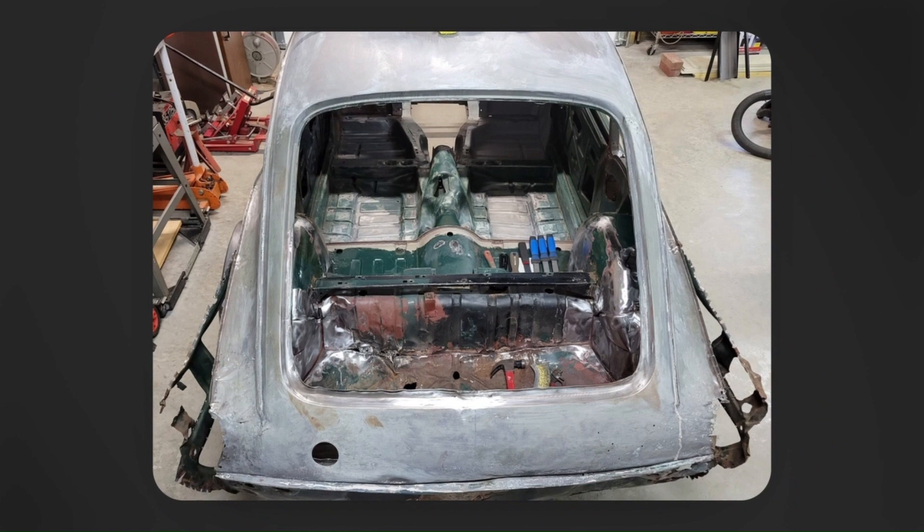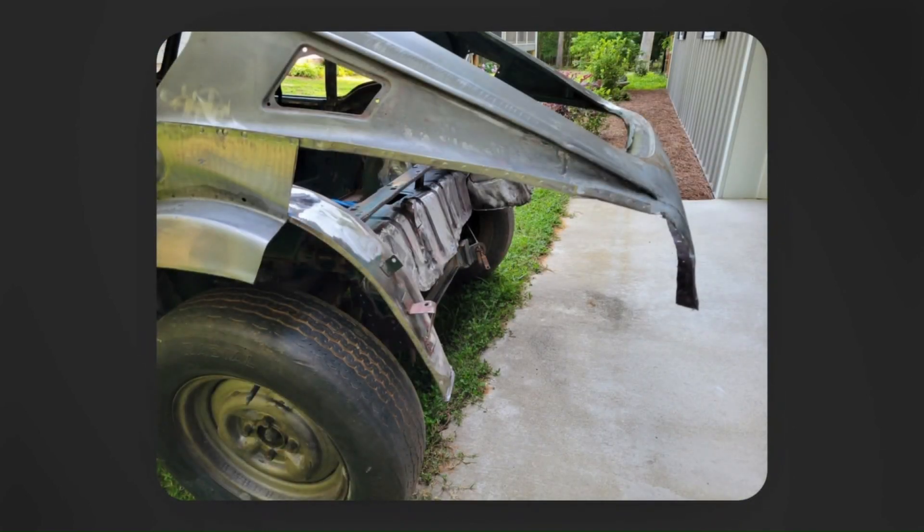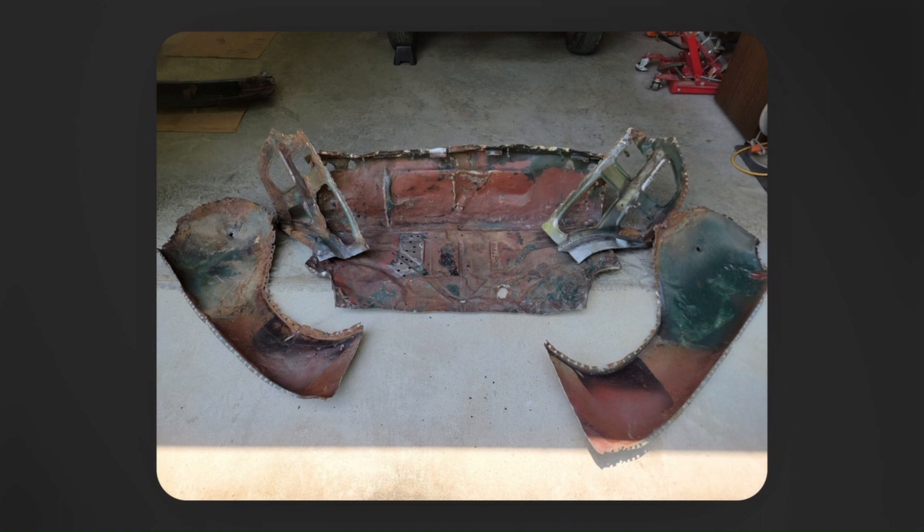Here's where I started splitting the rear inner wings, then I roughly cut those out. I could have salvaged more of the outer wheel arch on this side, but I decided to do roughly the same operation on both sides, cutting well short of what the inner wing patch panels will cover so that I have plenty of margin for error. And then finally, around Memorial Day, I cut out the mangled boot floor and valance as a single unit — leaving the boot floor and valance attached to each other and removed them that way. The rear wings weigh a ton because of all the body filler applied to them, and the valance and boot floor have long been disastrously mangled.